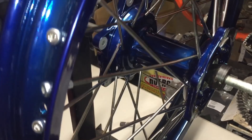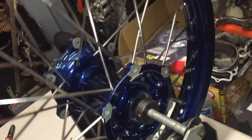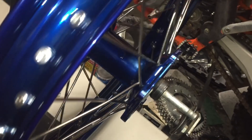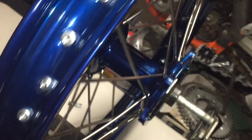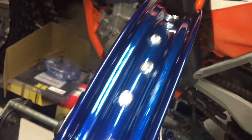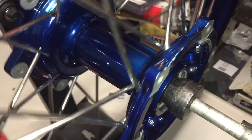It's going number one. The rear is all done — it's all nice and true. These new stainless spokes are just going to look killer on this bike. All trued and tightened. I have a spoke torque wrench set to 60 inch pounds to set the spokes. I know I'm going to have to come back again and set them again. But it is truly a beautiful powder coat version of anodized blue, and it's just going to look phenomenal on the bike. Really excited.